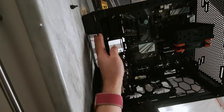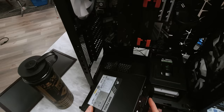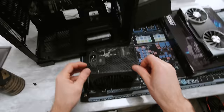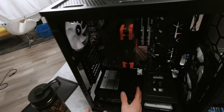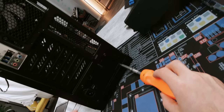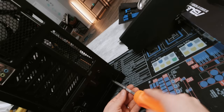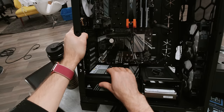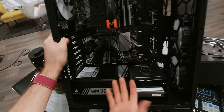I'm going to go fan side down because this case has lots of space on the underside to draw in fresh air. And I'm going to be a smart, responsible computer owner and not put it down on a carpet. For some reason there are screws in the back of this power supply — that is not normal, you will find the mounting screws in the power supply box. Now as we're putting it in, we can just place it down, push towards the motherboard, and then slide into the back of the case. You might notice at the back that there are going to be some extra mounting holes here that you're not using — that's normal, that's in case you want to mount your power supply in the other orientation.